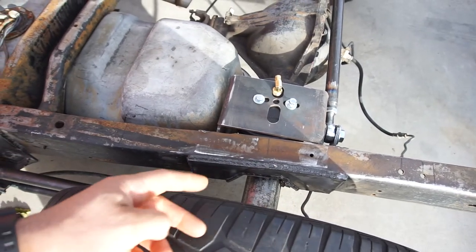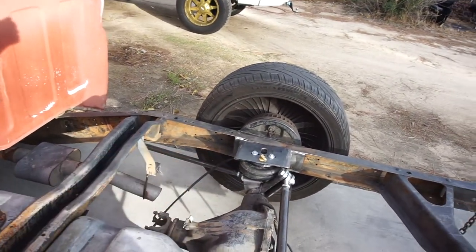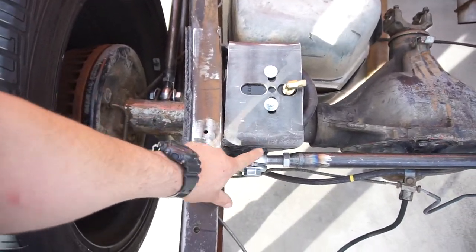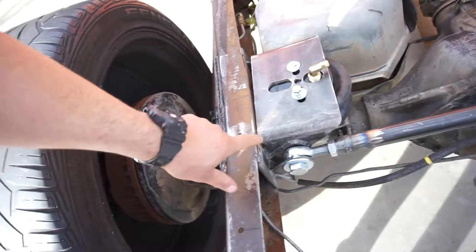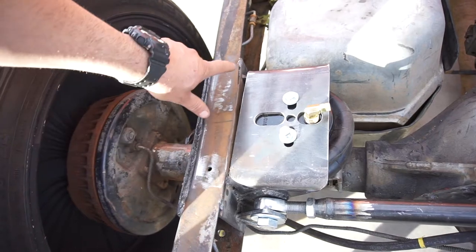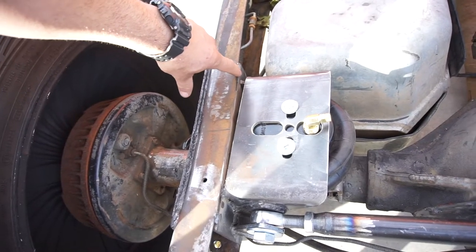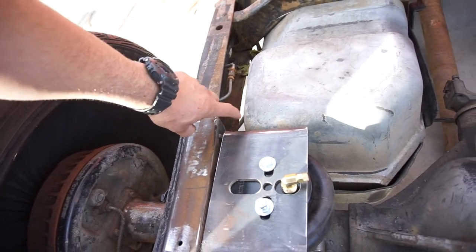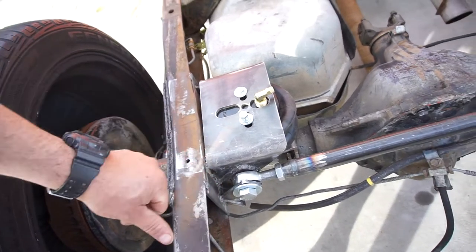I did box the frame — the frame is boxed with a little c-notch, or whatever you want to call it. It's boxed the same on the inside. I ended up having to do the panhard bar — I do attach it to this airbag bracket. This isn't welded yet; I'm going to run the TIG weld over this to clean it up. What I'll do with the TIG is melt through the frame metal into the eighth-inch or quarter-inch steel that's back here.